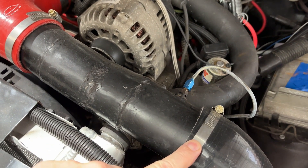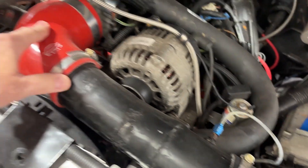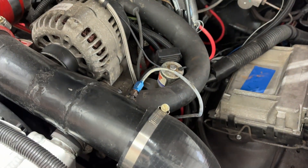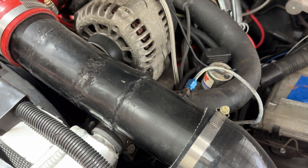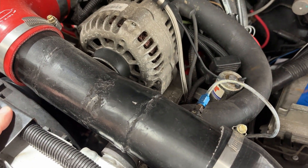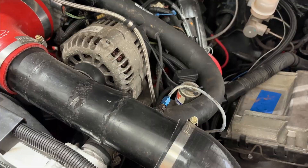The second way we're going to get our 60-foot times down — let me show you. This is my air intake tubing coming out of the intercooler, through the piping, into the throttle body and manifold. You can see this little tube and solenoid — that's a dry shot of nitrous. I believe I put in a 35 shot. I'm going to open that up and take a look, because I think we're going to turn it up a little bit. If it's a 35, we're going to a 50; if it's a 50, we're going to a 75. I'm only using the dry nitrous — there's an arming switch and a button on the steering wheel that controls it regardless of throttle position.